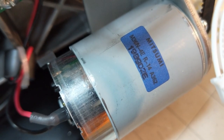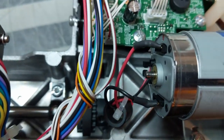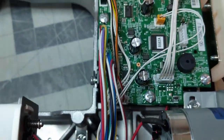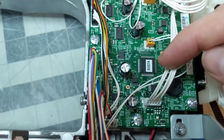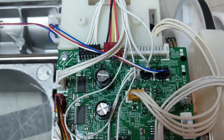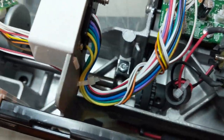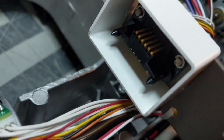Between a Mitsumi motor — it's going to be a pulse-width-modulated motor controlled by all of this stuff right here. We're not going to go through all of those components, but you can see you've got a buzzer right there, and that — 8582A — is the brain of the operation. These wires are the ones that go to your arm and all the servos that run the embroidery hoop through that connection right there.